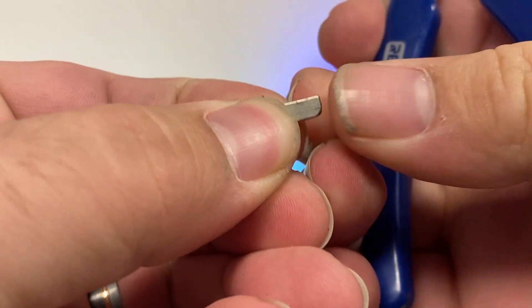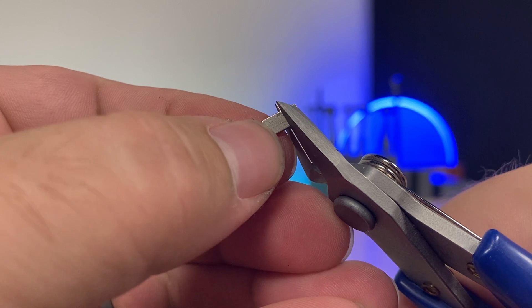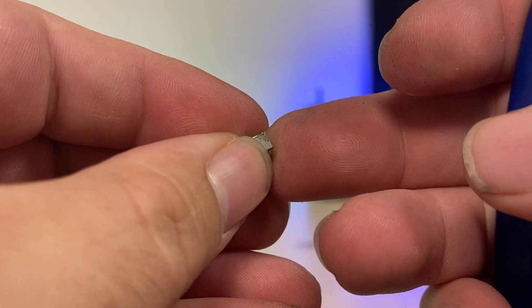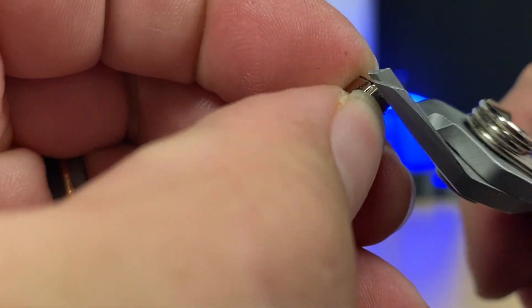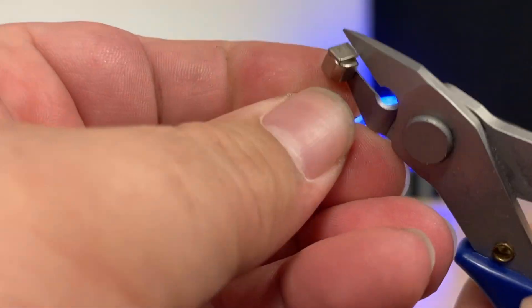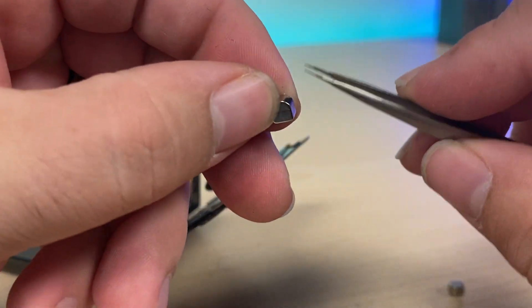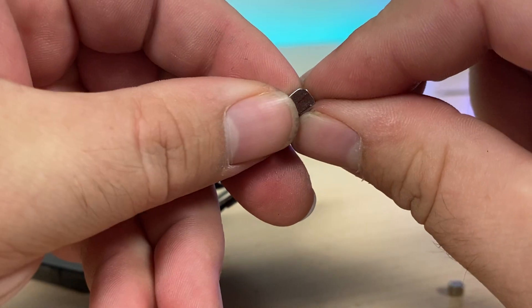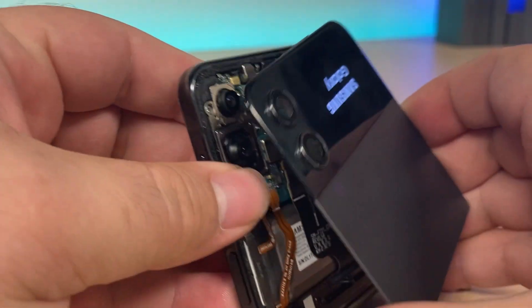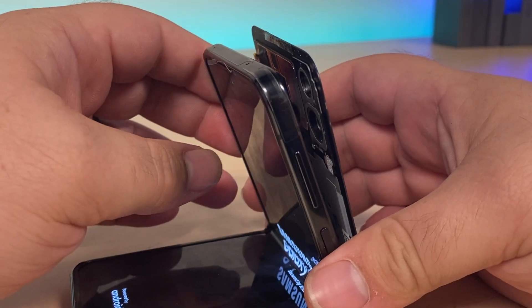Here you can see I've got one of those little iPad mini magnets. I'm going to take some snips and cut it right there. I need to take a little bit more off to make it the right width. Now I've got it the right length. The red line goes horizontal and you'll see there's a little notch, a rounded side to it — that goes up in this corner, positioned so the red line is horizontal, just as it should come pre-installed.